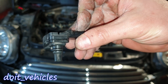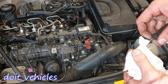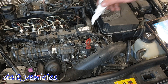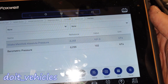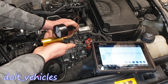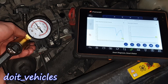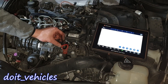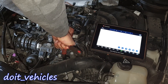It looks like there's supposed to be a hole but it's not anymore due to carbon. Now the sensor looks a lot better after cleaning. I know that to properly clean the intake manifold I have to remove it, but at this point I just want to see if the sensor works. So I'm just going to do some local cleaning. Now I'm going to connect the sensor back and turn the ignition on — we've got 101 kPa. Let's connect the hand vacuum pump. The sensor is responding very well — it goes down to 50.